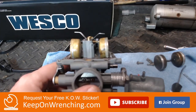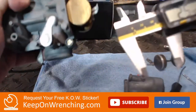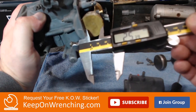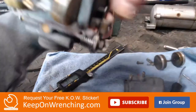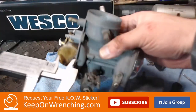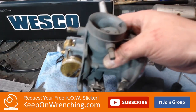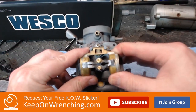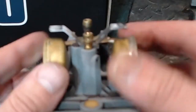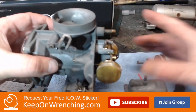One other thing I keep neglecting to say: you want to measure both sides. If we're measuring this, we go 26 out to that drop-down point on that valve. Then flip it around and do the other one as well. Don't forget to do the same process for both sides — both of them have to be right on. If one is higher than the other, you can torque the float down just a little bit. Just make sure both sides are at that right space.